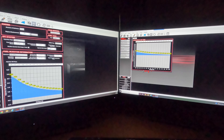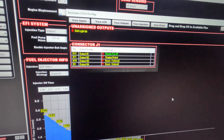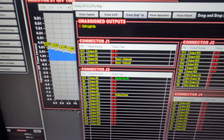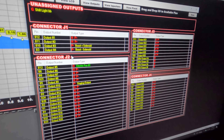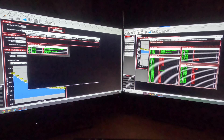There are some differences I'd like to point out in the pin map. The biggest one is that on the Terminator software, B12 on the J1 connector is your electric fan output, which is a ground output. On the Dominator software, B12 as an output does not have ground as an option. So for my particular tune, I moved to B12 on J2 instead of J1, which requires some physical wiring changes. On the positive side, my boost solenoid output wiring carried over with no differences, and I was able to reuse my rev limit, trans brake, dome pressure, bump, scramble, and flex fuel input. My J1 connector on the input side was unchanged, which is quite nice.